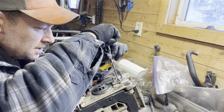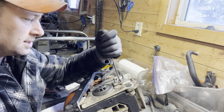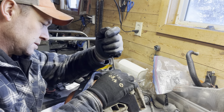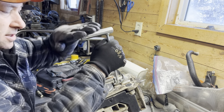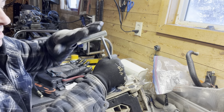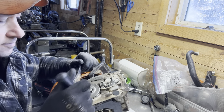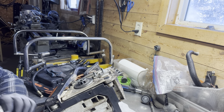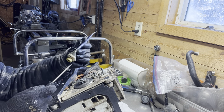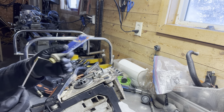Just make sure that she is functioning. If you don't loosen your bar nuts off when you go to adjust your chain, then you'll end up stripping the threads on your chain adjuster — it's just a small bolt basically. And if you end up over-tightening your chain, you can also put a lot of extra torque on those threads. You really shouldn't need to have that much tension on a chain at any time.